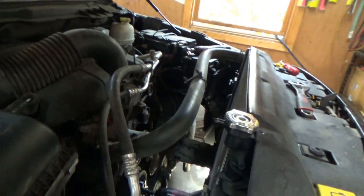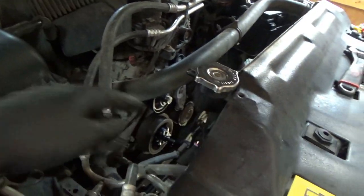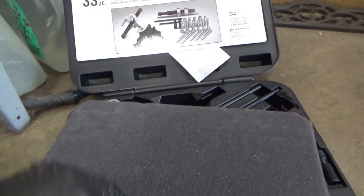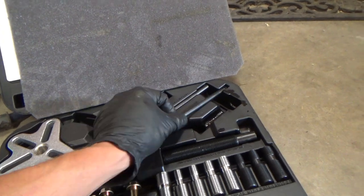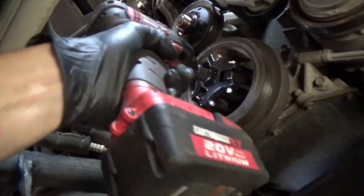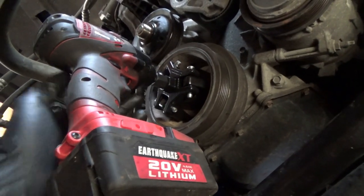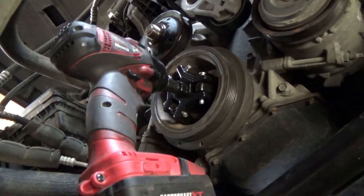I started the teardown — got the cooling fan, radiator fan, shroud, and belt out of the way. You have to use a puller kit, so I got this from Advance Auto. It's pretty versatile, but the rod that goes into your crankshaft is too short, so I had to improvise with a couple of adapters. The forcing screw is very short, so you basically have to keep adding spacers and pull the whole thing off.